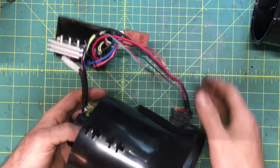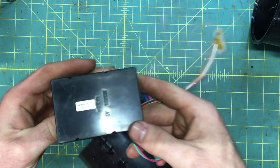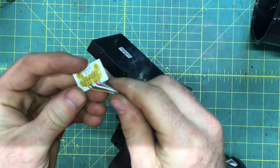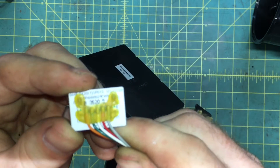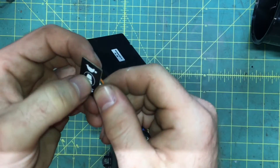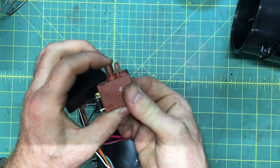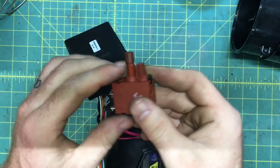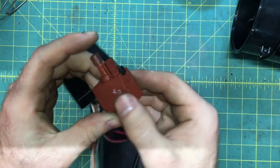Once all the plastic bodywork is out of the picture, you can see where your $170 really goes. Doesn't look like much, but I'm seeing some serious power here — way more than even the mighty M18 high torque impact we took apart already. The turtle and bunny settings, as well as the LED indicator, are crammed onto this little interface board. You can tell by how thin the wires are that no real power goes through here, just communication signals. Still, it's always good to reinforce wiring wherever human interaction is anticipated. The trigger switch looks familiar, but there's some weirdness here — it's got a beefy diode to protect the switch from flyback voltage spikes when the motor suddenly stops. But why wouldn't the half-inch impact need one too? And oddly, it looks for all the world like a reverse function — does this thing have potential for blowing and sucking? Questions for later.